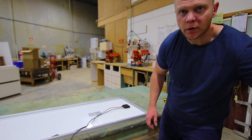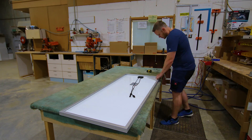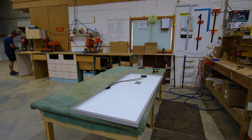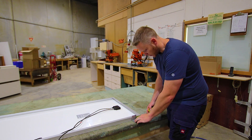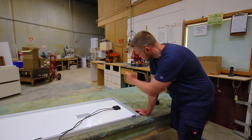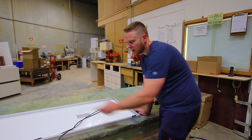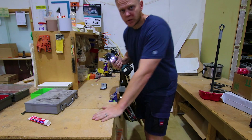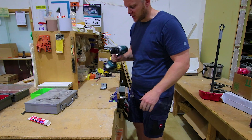So what I've done up on top of the car is worked out where the brackets are for the awning. I'm going to put the front one slightly back and the back one as far back as I can go. I've marked where these need to go with a permanent marker. This is going to be the front of it — the awning bracket sits just there, so I'll have around 60–70mm overhang on the front. I'll copy these lines across to the other side because it has to be symmetrical. Then I'll work out exactly where the centre is for the centre one, correlate those lines to that side, and start drilling some holes. The best way to drill in metal is with a step drill — it just works the nicest. Trying to change drill bits and do all sorts of funky stuff? No — step drill, that's the way to go.